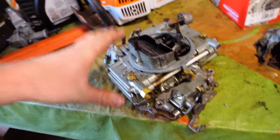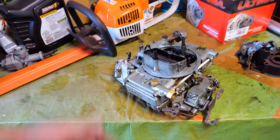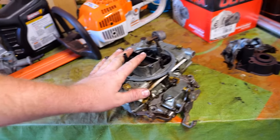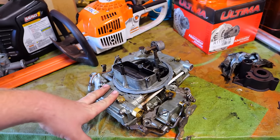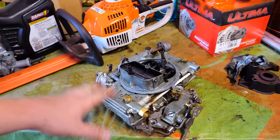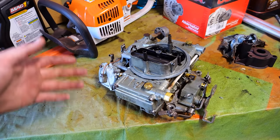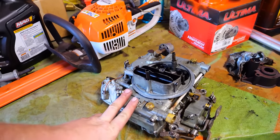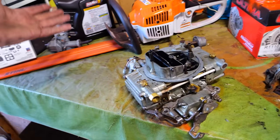Because if you're carrying a whole bunch of weight and you snap a bunch of power into the driveline, you're likely to snap a U-joint or break an axle or something like that. So this keeps the power delivery smooth. This is paired with the distributor, which also has some governing systems in it. So we're going to try to keep this one and make everything work for the sake of the dump truck and not breaking stuff, especially since I'm just borrowing this, not owning it. I want whoever hops in this to be able to turn the key and operate it normally.